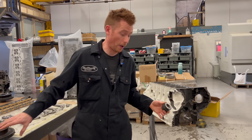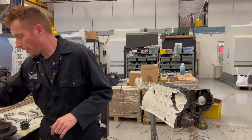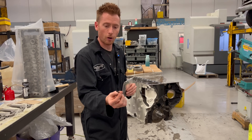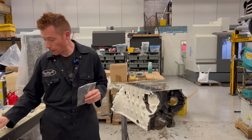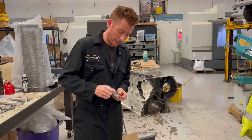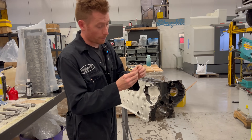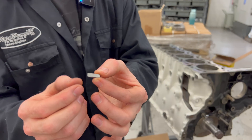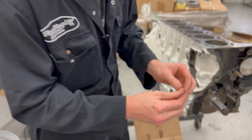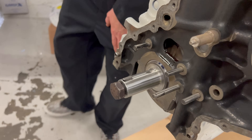The drive gear at the back is under more of a permanent consistent load and isn't trying to absorb harmonics, which is why it never spins. Mercedes have actually already thought of this — if you try to buy the old keyways, you can't buy that little slip of steel anymore. When you order them now, this is what you get — a pair of standard Woodruff keys that just push into the original grooves. You don't have to modify anything; just pop them in and give them a little tap with a copper hammer.